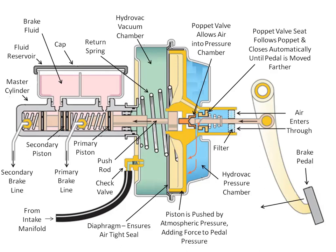On the other side is the vacuum chamber, and this side does not give opposition to the force being applied during the braking action, making it lighter for the driver's exertion of force, because the atmospheric pressure will assist in pushing the push rod and the master cylinder piston.